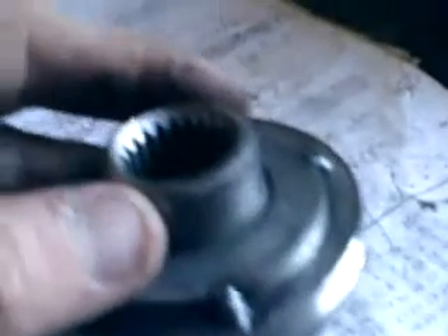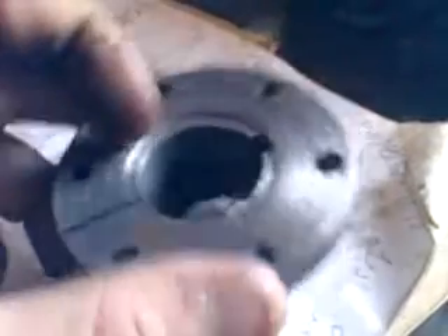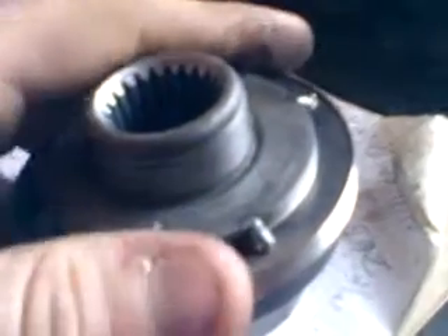The new plan is to have this clutch disc hub, which was taken out of a stock clutch, and couple it to this piece made by Grainger. It's an inch and an eighth bore, and I've made a register on here with a lathe. That registers right up with the outside diameter of this clutch hub, so it centers right up on there.